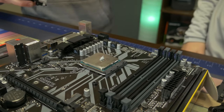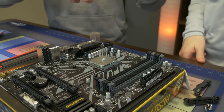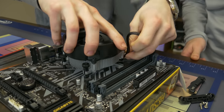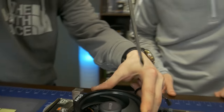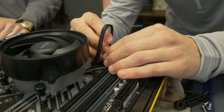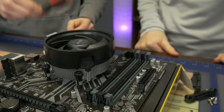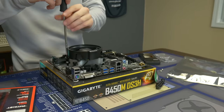For the cooler it literally lines up with these mounting points. Now I'll teach today's cable management — this is very near and dear to our hearts because it's important. Normally most people would just put it on and leave it like that, but when it's in your system it's gonna look ugly. So what we're gonna do is hide the cable kind of under the screws. I'm gonna get the screws started and I'll have you do it. You want to do opposite sides for equal pressure, and then you can go ahead and plug the fan header in — it can only go in one way so you can't really mess it up. See the little groove on it? Just push it straight down. Perfect. And you see how that looks a lot better — once the RAM's in you won't even see it. Screw these in and push down because there's springs on them; they'll stop themselves once they're all the way tight.